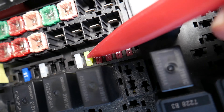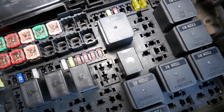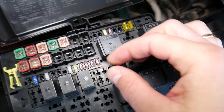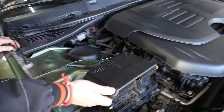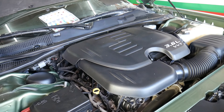These fuses — one is 25 amp and one is a 20 amp fuse. I recommend always testing fuses and relays if you're in doubt that they're bad, because sometimes just looking through them after you remove them, you cannot tell if they're good or bad. We'll put a link to a special video that will teach you how to test a fuse and a relay as well — in just a few seconds you'll be able to test yours.